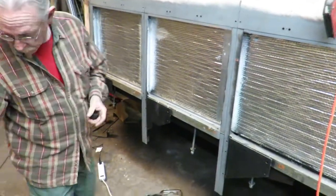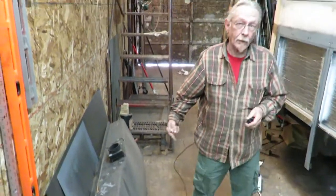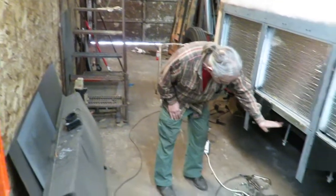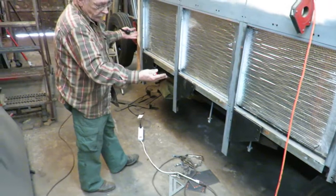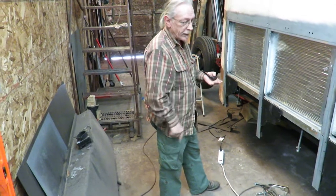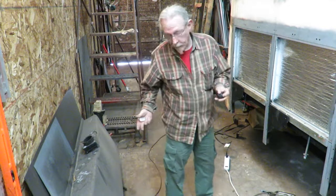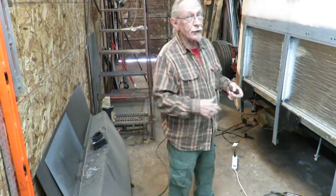There is a 44-gallon tank, which will be strictly gray water now. I'd originally planned on a black water, gray water combination. I've got all the bracing and brackets. It fits right up underneath here. That'll give me enough that, between the shower and sink and that sort of thing, it'll take quite a while to fill that thing up. And I can dump it virtually anywhere because it's just gray water. It won't have any of the nasty stuff in it.